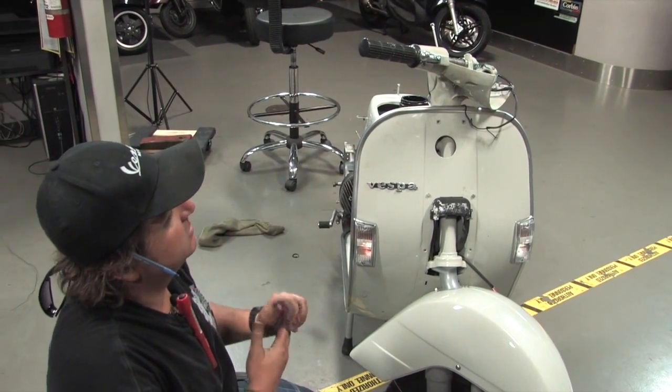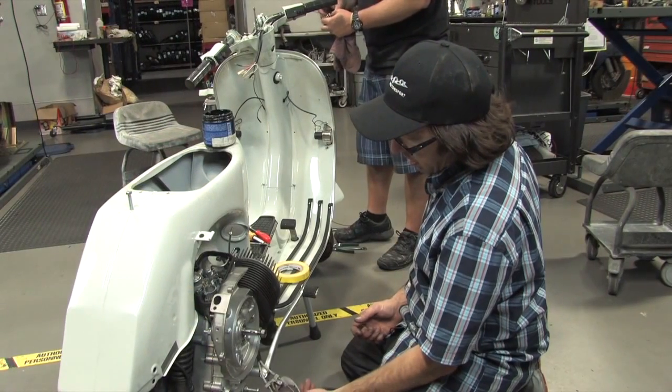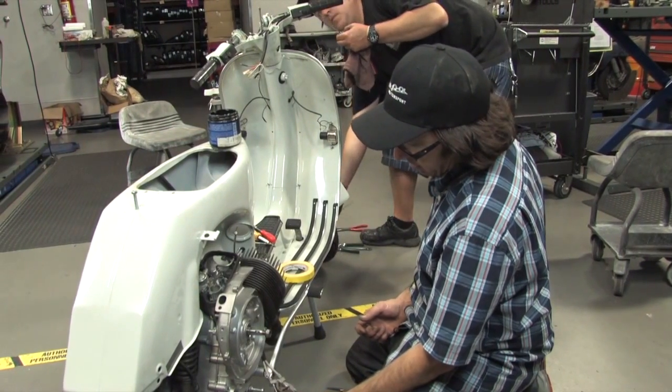You want about a quarter to half-inch of free play at the lever plate. With a fresh set of brake shoes, keep in mind new shoes tend to take a little time to bed in.